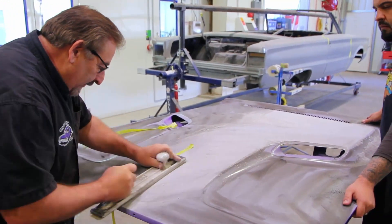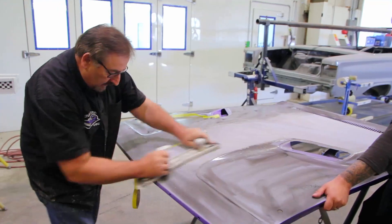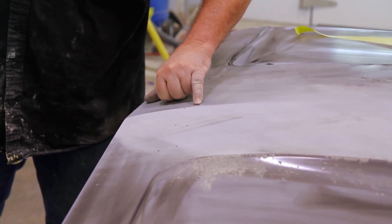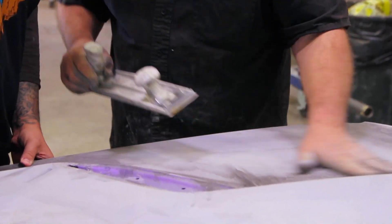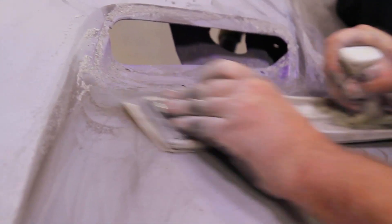220 is not very aggressive but it will take those orange peels out. We've got a bow in the hood, so we want to bow it, come back and comb it. We've got a nice line right down the middle of the hood — it should come down evenly between these two letters, because this is the center of the hood right here where the D goes. You've got to be a little bit careful right here when you're going this way — but look, it's barely cutting, so I'm pretty cautious of it.